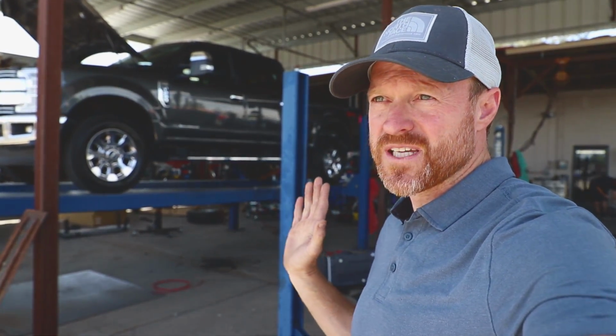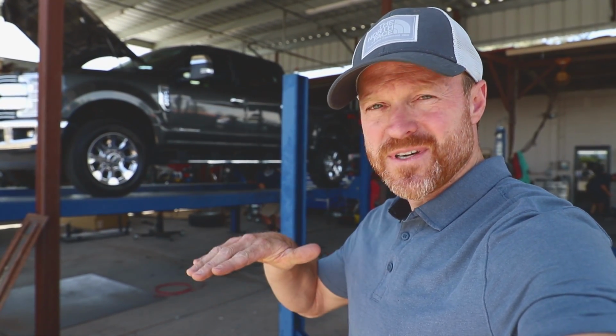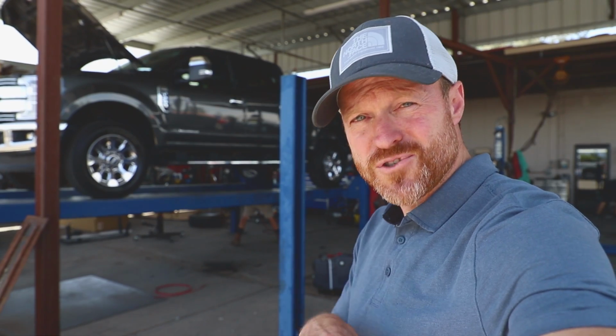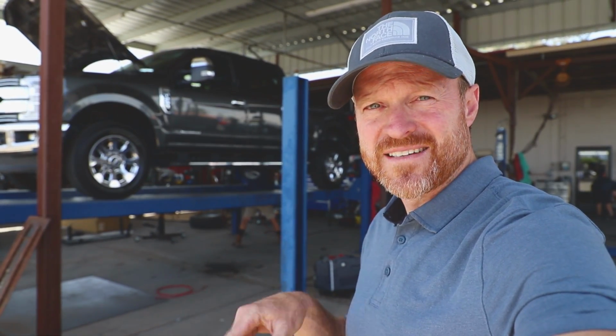And what that does is it transfers the weight to the front of the tires. If at that point you were to increase the air of the truck, you're essentially taking the pressure off the chains, negating the whole purpose of a weight distribution hitch. So depending on your system, it's important to check out if air, in fact, is going to be a detriment